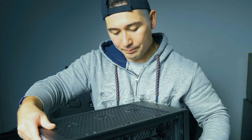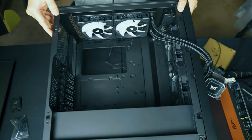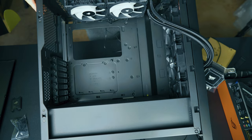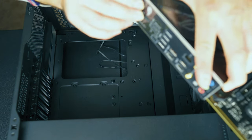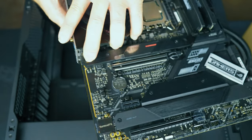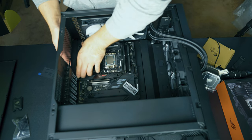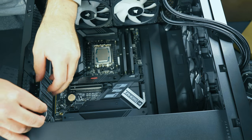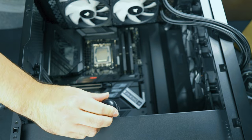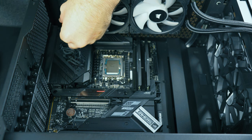Let's lay this onto its side carefully — make sure you are very careful with the pump. When you look at your chassis, you're going to see it has certain areas where you can lay the motherboard on. Make sure you lay it right on top of the mounts that are already on your PC case, so that way when you sit your motherboard you don't have to worry about shorting it. Make sure you take off the IO sticker in the back before installing it. The easiest tip I can give you is to line up the IO plate in the back — it'll kind of click into place. As soon as it does, you can install each screw. Some chassis will have one mount where you don't have to put a screw, so just pay attention to your PC case chassis to see if it has that extra mount already.